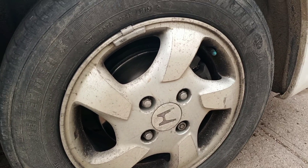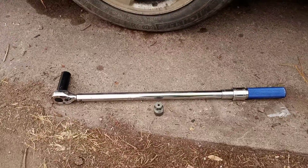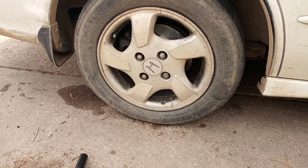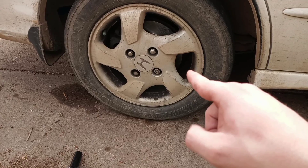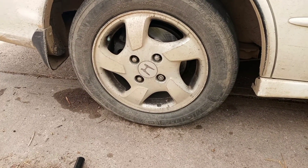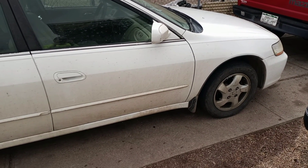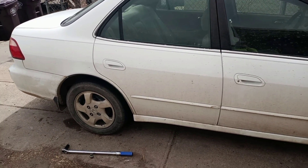Brand new brakes on the front and brand new brakes on the back. I'm going to torque my back wheels — it's important to torque your wheels. When you finish a job like this and go to put your tire on and accidentally snap a wheel stud, that's when your bad day really starts. I usually do about 85 foot-pounds for a car this size. We're gonna go wash this little animal and give it a test drive. Yesterday the front brakes performed flawlessly and I have no doubt the rear ones will. Thanks for watching everybody, please subscribe!